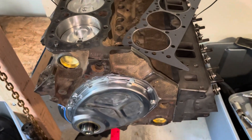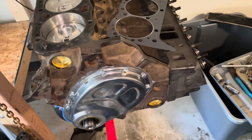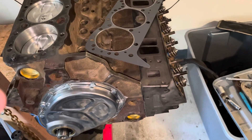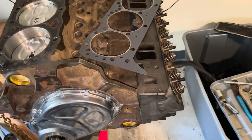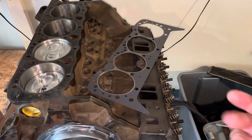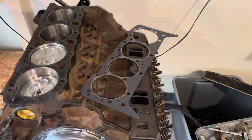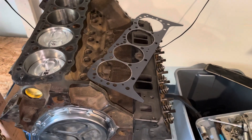I'll show how the water pump has a mating hole for this when I install it. For marine engines specifically, water flows constantly through the block in a circular motion. When it gets hot enough and the thermostat opens, that water goes out through the exhaust manifolds and draws in new water. Marine systems have two loops: one is the sea water pump or outdrive pumping raw water up to the engine, which normally just passes through the thermostat housing and out to the exhaust manifolds. The engine's internal loop draws from that external loop when the thermostat opens.